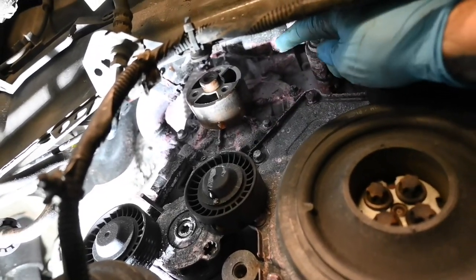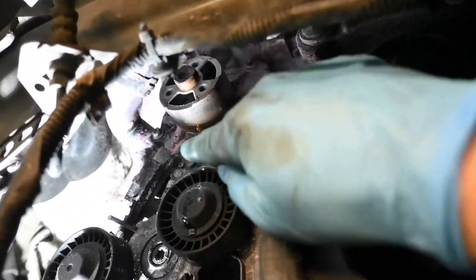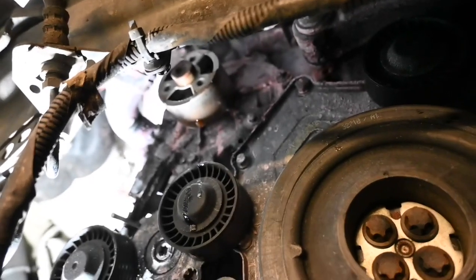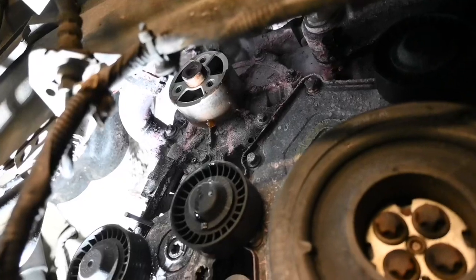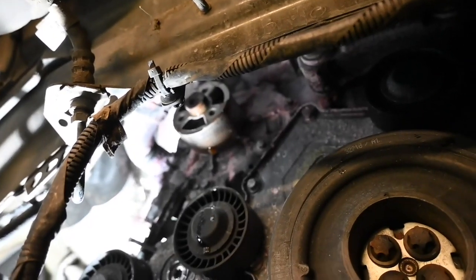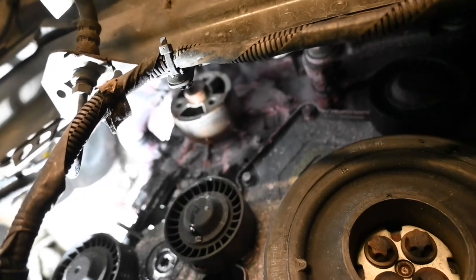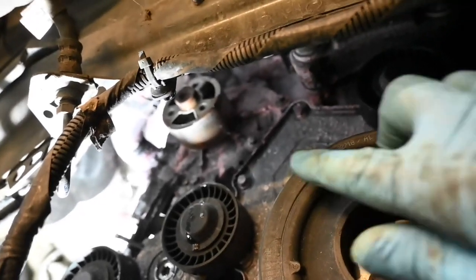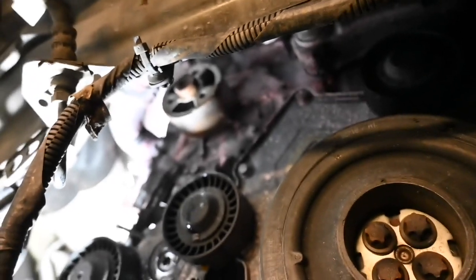The water pump has six 8mm bolts holding it in. My next step is to start cracking these off bit by bit, bearing in mind that once you crack them off, coolant is potentially going to come out of the engine, so I need to put something underneath to catch as much as possible. Most people will probably drain the whole system through the lowest radiator hose, but the water pump is quite high up so I'll probably only lose what's in the top part of the engine — I'd rather save as much as I can.